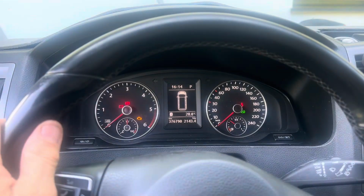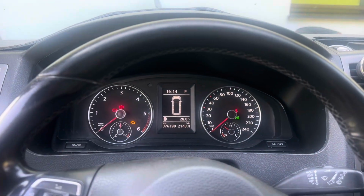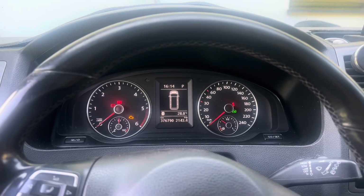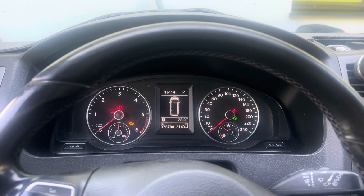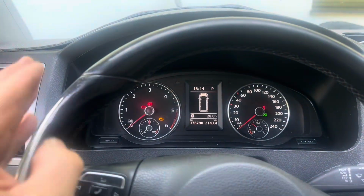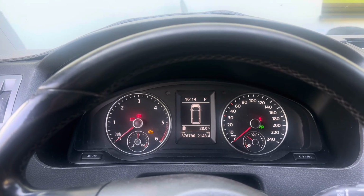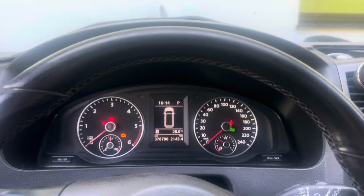Now you can still drive around with the vehicle like that, it's just going to be a little bit more wallowy at the front. So I'm not going to jack it up and do anything else now. That's good to go. I'm going to go online and order some new links, and replace both sides, because I actually don't know whether it's that side or that side. All I know is that now there's no force on it, the noise has stopped. They're about €45 or £40 for the pair.